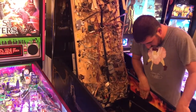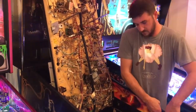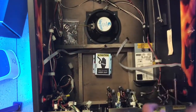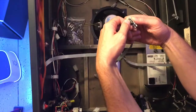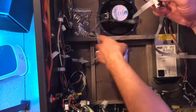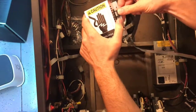Work that crease out. This wire we're going to lay right in there for now until our connectors come in. Then install the other side the same way. For the power box, you've got two plugs — each one goes into the box, make sure it's the right way. Nice job getting both in — two for two! Put it in the side of the box, kaboom.